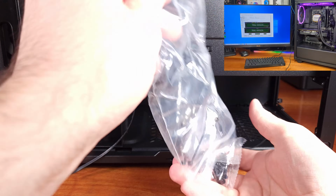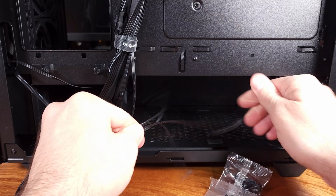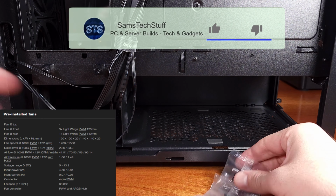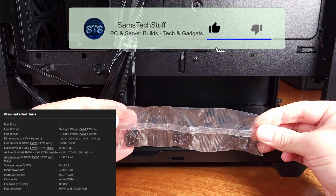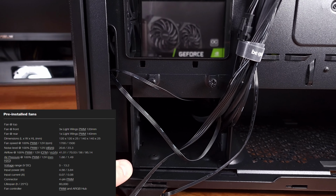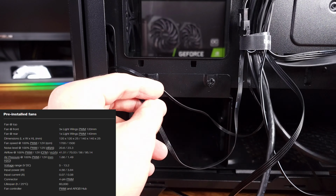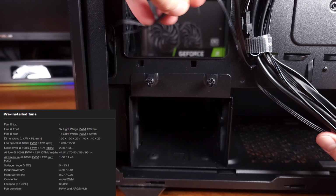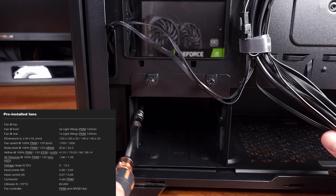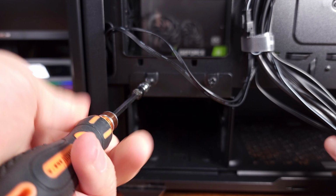The 120mm intake fans have a maximum speed of 1700 RPM at 20.6 dBA of sound output, which produces about 1.6 mm H2O of static pressure. The 140mm rear exhaust fan has a maximum speed of 1500 RPM with a maximum sound output of 23.3 dBA, producing a static pressure rating of about 1.49 mm H2O. Like I said, this fan arrangement should be sufficient for most gaming rigs.